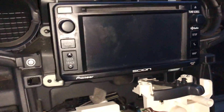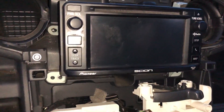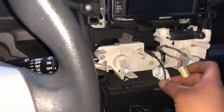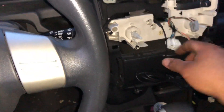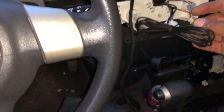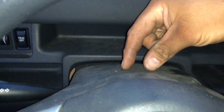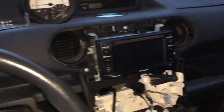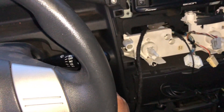I'll put pictures again if you don't remember how to plug it in. It took a little finessing to get the wires to fit back there. I decided to route the microphone wire down the HVAC duct, same with the USB and aux cable — running it all the way down to its original spot. For the microphone, I'm going to see if it's long enough to go up above, maybe on the A-pillar or double-sided taped somewhere — I'll find where I get the best audio. It's already connected, so let's see if it starts — moment of truth.